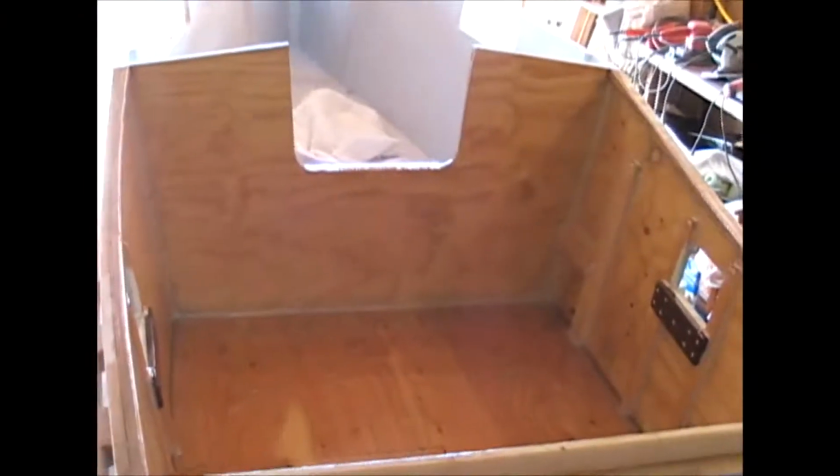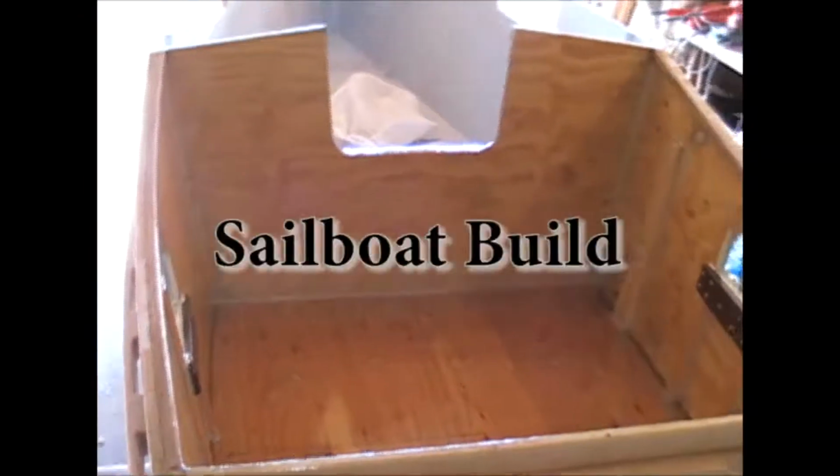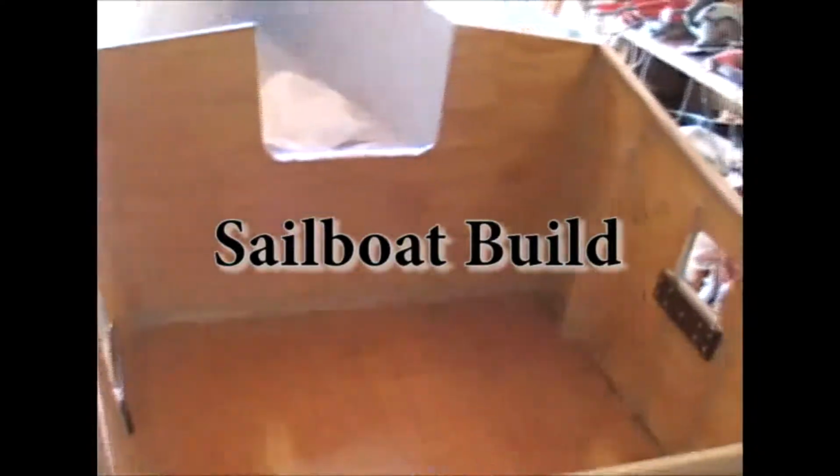Now October 14th. We had some freezing weather, but now it's warmed up and I was able to get the cockpit glassed. There's a layer of 10-ounce glass on the bottom and 6-ounce on the sides. And I just got the fill coat on. I glassed it yesterday, put the fill coat on today.